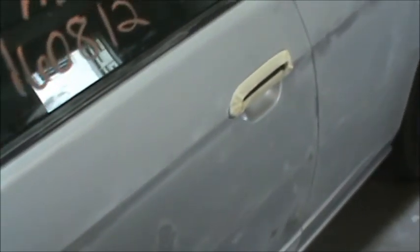So if you're going to paint the entire car, this is a good method of exposing your dents. This car has a lot of little dents — it has hail damage — and we're going to have quite a bit of body work to do because of that. That's how to expose your dents if you're painting the entire car. If you're not painting the entire car, you may want to use light to get different reflections. There are several different ways you can find a dent. A lot of these were not obvious just by looking at the car. Maybe took 10 minutes. So take it easy and thanks for watching.